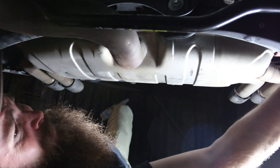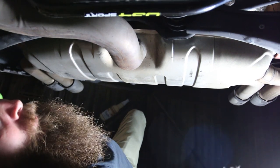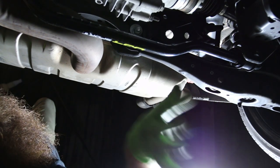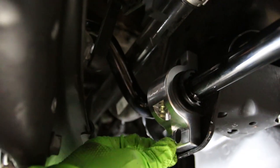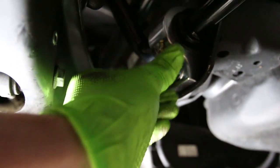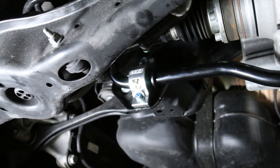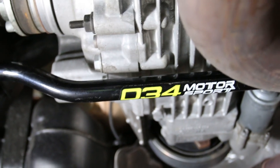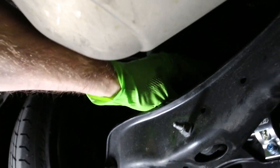Getting the sway bar back in — you just wiggle it until it works. Grab the mounts, slip them over the bushings already installed on the ends, and install the new hardware that came with the kit. It's a little bit longer due to the billet aluminum and the zerk fitting, which will help cut down on squeakiness. It looks really nice down there with the 034 Motorsport logo — adds some bling below the car.